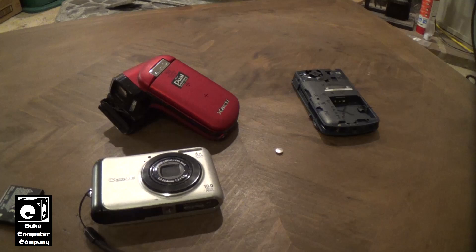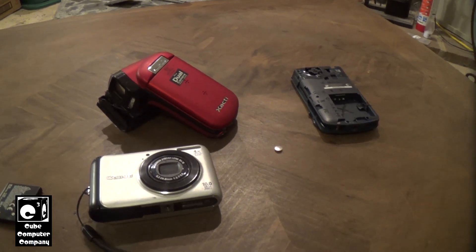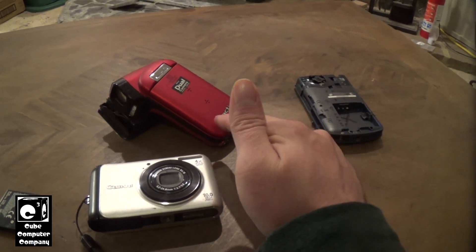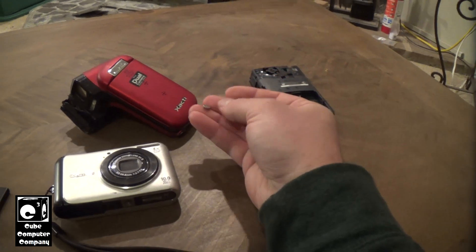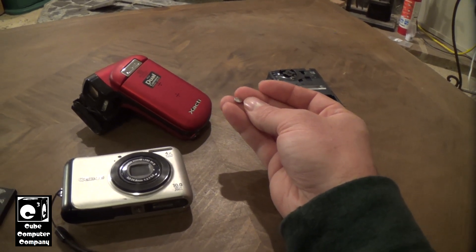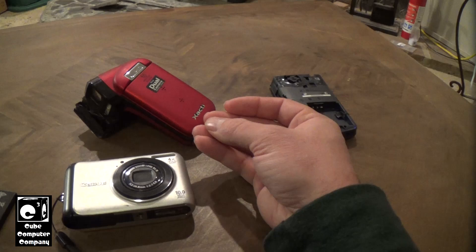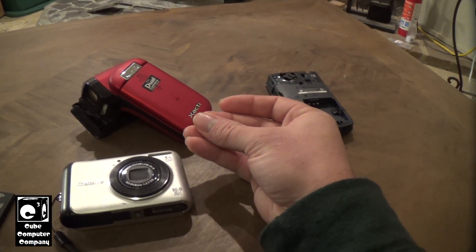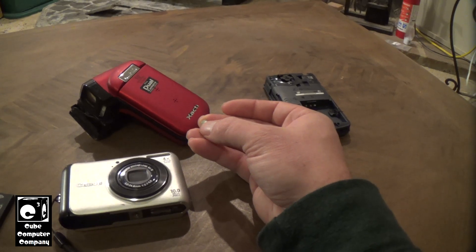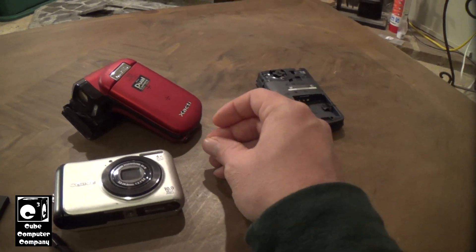In fact, in some cameras it's even worse. For example, the camera I'm filming with right now, the Sony Handycam CX220, and also this Sanyo Xacti CG20 — not only does the little timekeeping cell retain the date and time, it also retains all the settings for the camera. So when it dies and you pull your battery out or change it out, the camera loses the date, the time, and the settings. You have to go in and change back all your settings, and sometimes it can take minutes to do, and sometimes you might forget one. You go to shoot a video and it's like, 'Oh crap, I forgot to change that resolution back.' It's so annoying.